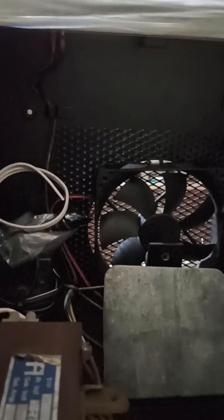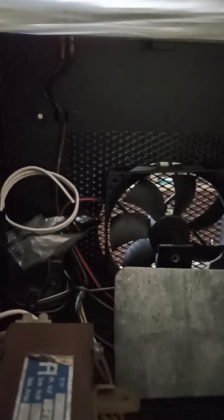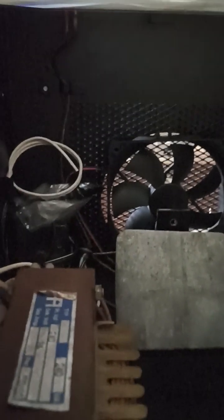And there at the back you can see the PC fan. It runs on its own power supply. It's about 7 volts. The reason for the separate power supply is because the 24 volt transformer is being handled by the dimmer. And there's also a much smaller deflector plate. The original one was much higher. There was no condenser lens, so the light rays would just pass and it can shine into someone's eyes.